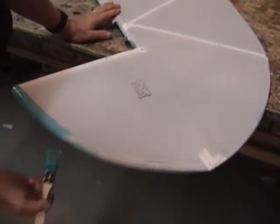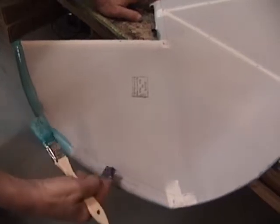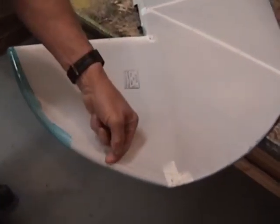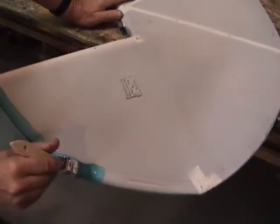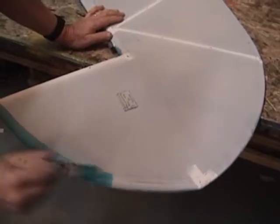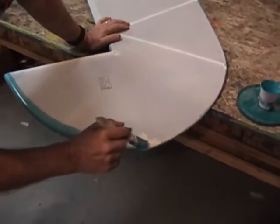You don't want to wrap it too far around. We don't want to get past the transition mark on the fabric where it leaves the structure — we don't want glue there. That way it'll have a very nice smooth lay when the fabric comes off of the piece of tubing. Just a nice wet coat of glue — you don't want it soppy and runny, just enough for the fabric to bed into when we start laying it into the pre-dried glue.